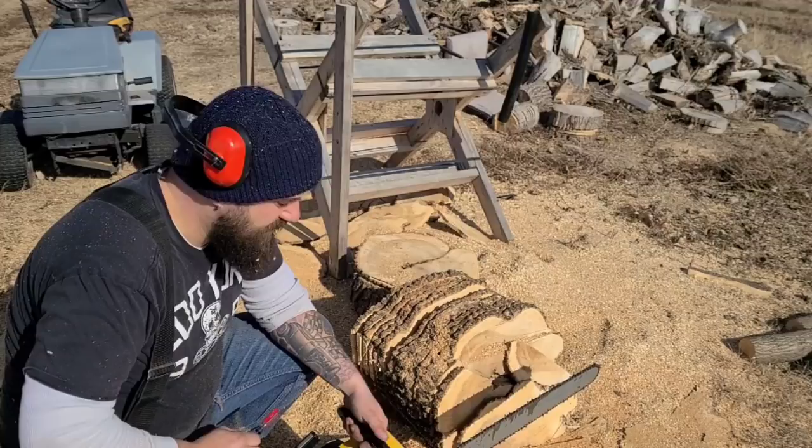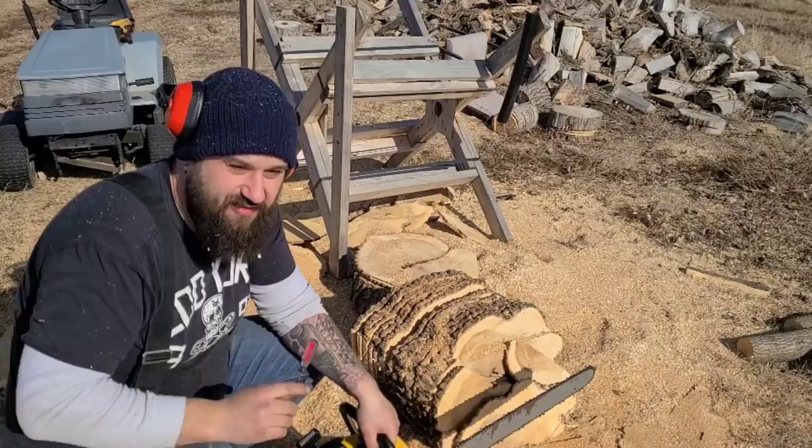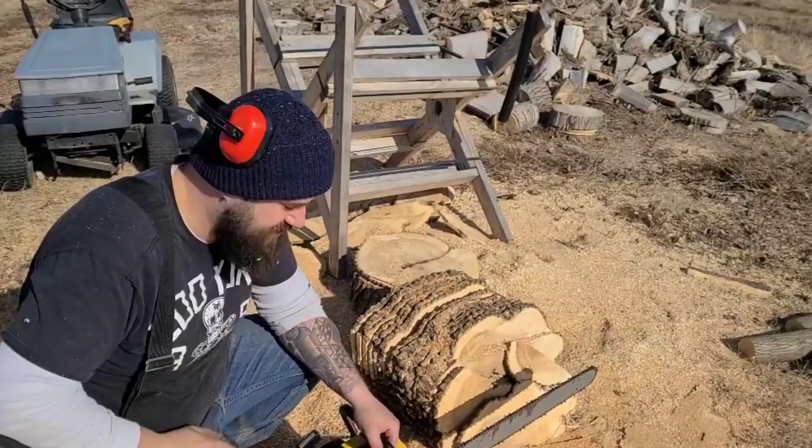So there you guys go. If you have a McCulloch or any power saw with bad points, you put that kit in there and you will solve all your problems. This thing never ran right from day one. It's still picky on the carb a little bit, but that's how these old saws tune. You gotta tune them slow and really listen. So I'm happy.